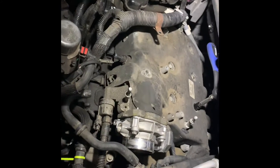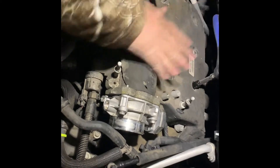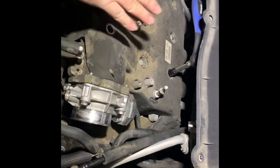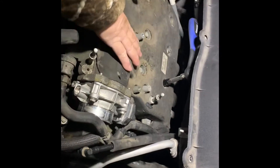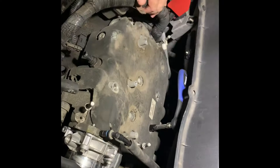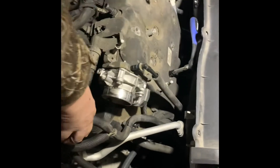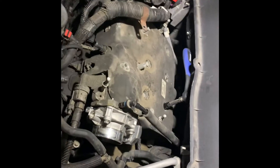So we're going to replace the coil and we're going to replace all the spark plugs in this car. But you know what you have to do to get down to the spark plugs and the coils? We must first remove the plenum right here. After we took all the hoses and put them all up out of the way so we can just lift this right straight up, we had to disconnect the throttle body. We've got a couple of connections here that'll have to be disconnected too, so we'll do those two along the way.